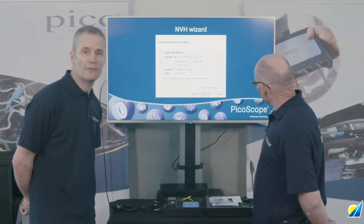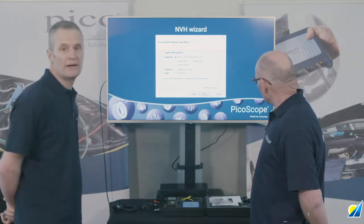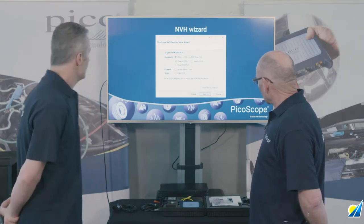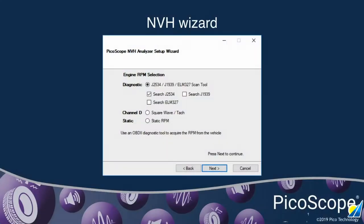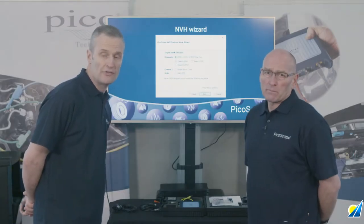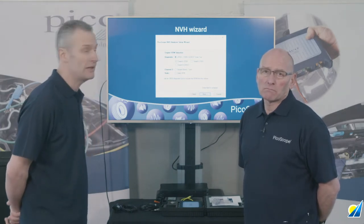The first step in vibration analysis is to obtain engine speed and road speed. The simplest way to get engine speed and road speed is via the OBD connector. The software is going to ask you which form, which protocol. We use J2534 for light vehicles. Heavy goods and commercial vehicles will use J1939. There is also an option for a universal ELM lead, but be aware that it will not work on a lot of vehicles — it's an option available if you have the ELM lead yourself.